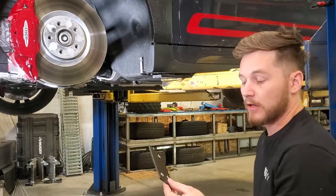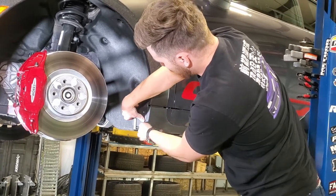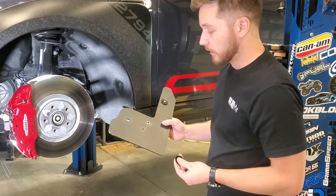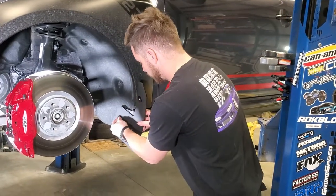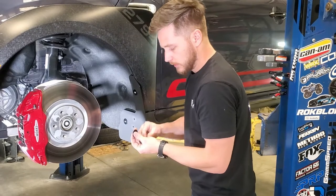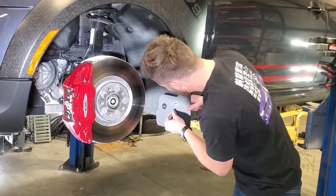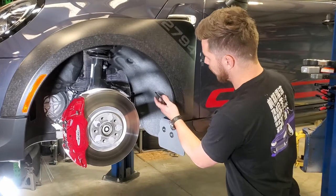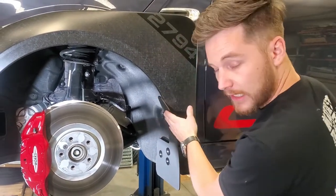With the bracket in place, take the backing plate, put it behind the bracket, then push the liner in and tuck it into the side skirt, aligning the inner hole with the hole on the bracket. Grab the flap and the half inch number 10 screws, put a washer on each, and start by mounting the inner mounting point. Get it started by hand, lift it up into position, aligning the other mounting holes, and use the remaining two number 10 screws, getting those started by hand as well. Then slide the upper portion of the flap in, align it flat with the fender, and pull it out so that the clip grabs the edge of the fender.